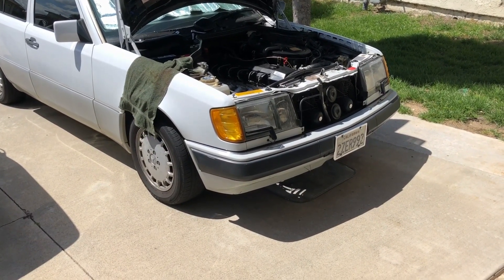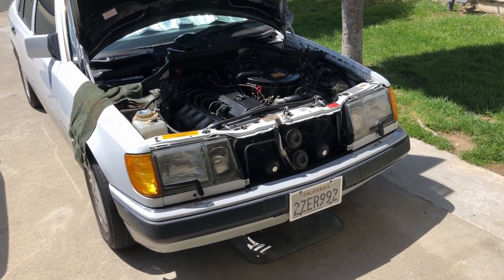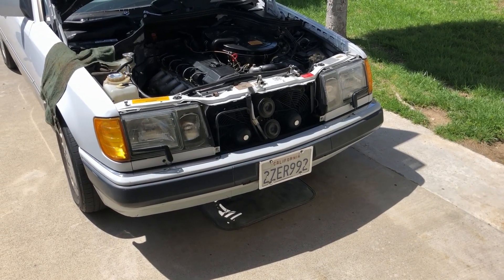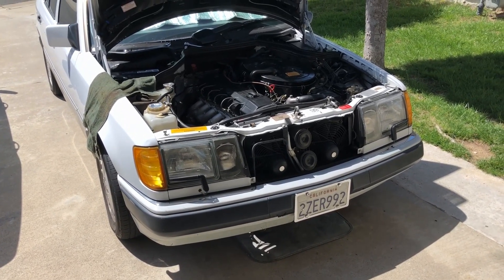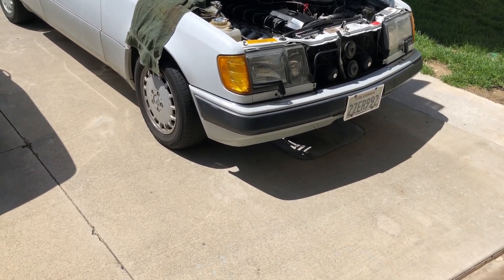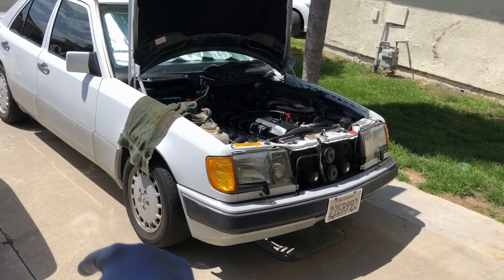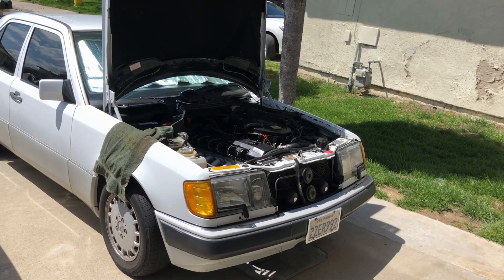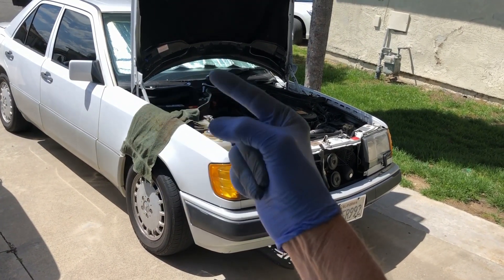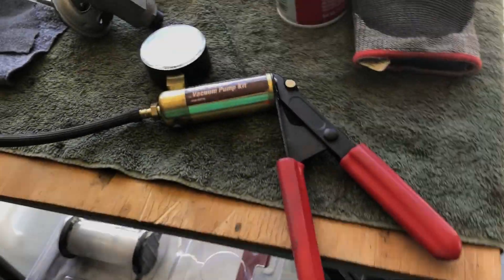I don't know - it's a 30 year old car but it's been well taken care of. I just did the head gasket last summer, the head looked good and straight. We did the cooling system, all tune-up parts replaced. I took the duty cycle, the fuel mixture EHA valve has been replaced, all the spark plugs. I'm going to pull the air cleaner off today and check out that throttle switch - if it's bad, the CIS computer might be thinking it's at full throttle all the time and feeding too much fuel.